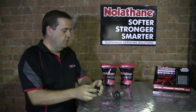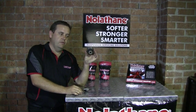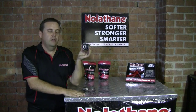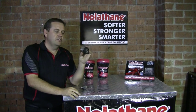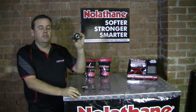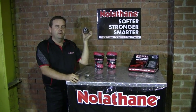The biggest thing we can say is, before this car even goes on the hoist as a GU Series 1 on the front panhard rod, you need to go over to the side of the car, put your hand on top of the tyre and against the guard, just give the car a slight nudge and you should be able to feel when this is moving left and right. As a side note, once we get to GU Series 3, there is one of these on the panhard rod at the chassis end at the front of the vehicle, and on the panhard rod at the chassis end on the rear of the vehicle.